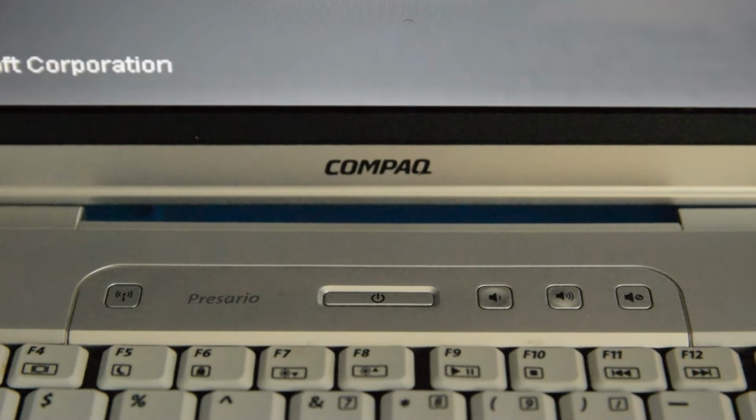Unsurprisingly, since that CMOS battery is gone, the BIOS resets its settings every time the system loses power, which is fairly easy since the main battery is dead. That being said, there's hardly any BIOS settings to change anyway, as typical for an HP device. The BIOS is version F.21, the latest release from 2007.